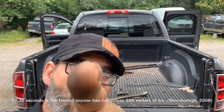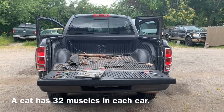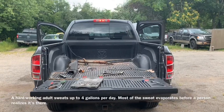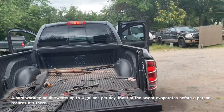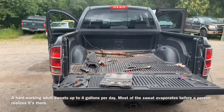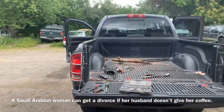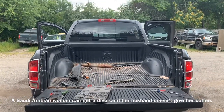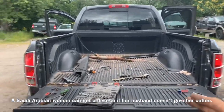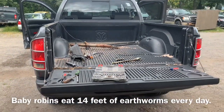Here's what we've got: we've got a Dodge Ram and the tail lights aren't working. Press on the brake light, Dakota - okay, so we've got a third eye brake light, no brake light over here, no brake light here. Turn on the four ways, Dakota - we've got a four-way right there, no four-way right there. Turn the running lights on - we've got a running light there and a running light there. So we're going to disassemble these.